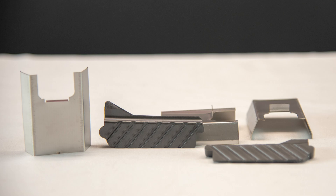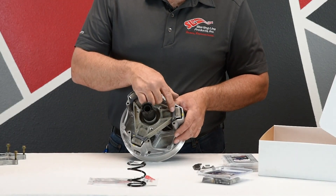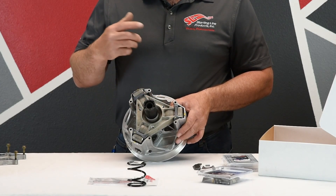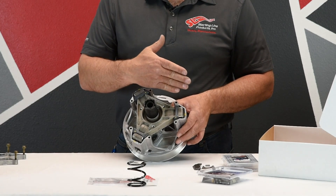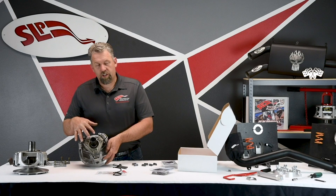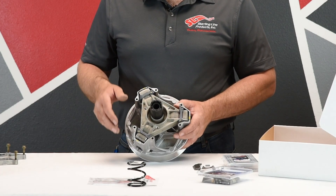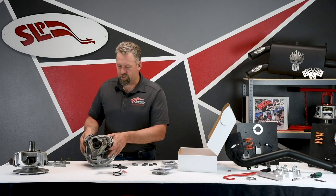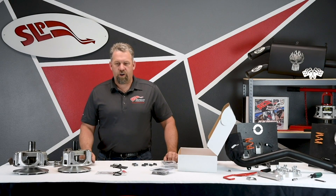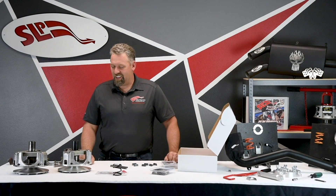The stock clutch slider is a beveled, triangular-shaped design that sits in the clutch, and when centrifugal force acts on it, it pushes the slider out. The design is such that each slider is meant to slide at the same relationship to one another to keep everything centered. However, when dirt gets into these clutches, the sliders stick, giving you a ratchety feel when you try to take off — a huge annoyance, especially when rock crawling, pulling onto a trailer, or just pulling out of your driveway.